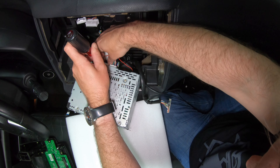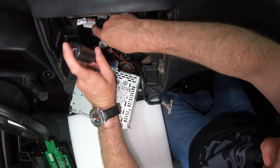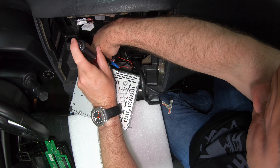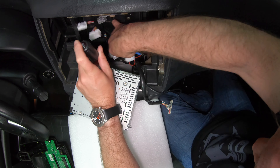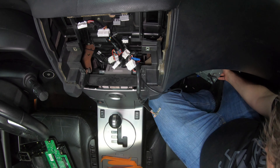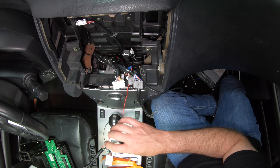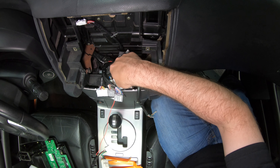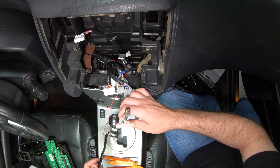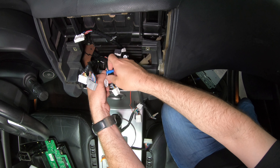So inconveniently, the release tab is on the bottom, which you probably can't get to easily without that display off, and there are four of them. Now that is the factory radio completely out of the car. This is part of that Grom harness that I'm not using anymore, so this can come out completely. This is the factory antenna, and I think that is part of the CAN bus. Let's look at what we got and see how it matches up.